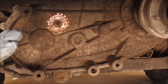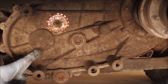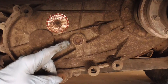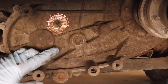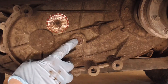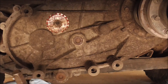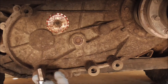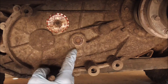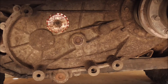Welcome back guys, Full Scale Fixes. Today I'm going to demonstrate how you can check your transfer case fluid. Pretty simple, nothing too crazy. We're going to take this top plug off — there's the bottom drain plug, here's the fill plug. We're going to take this one off. It should be a 10 millimeter hex socket Allen wrench style. I only have a 3/8 so we're going to try that. Take that off, check the level, and that's it.